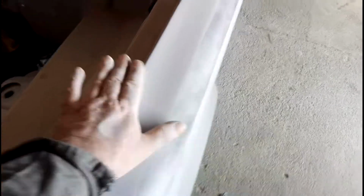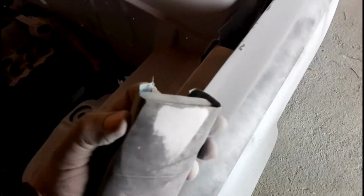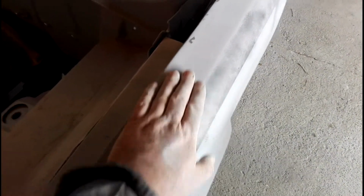But you can see where that guide coat comes in real handy, and that X pattern sanding gets it out. Now, it probably doesn't hurt occasionally, where you get a curve like this, to run backwards and forwards a couple of times, as long as you're not doing it all the time. Like I jumped to a slightly thicker block before, just to get a little more pressure in there and a little extra material out to get the worst of that black out.